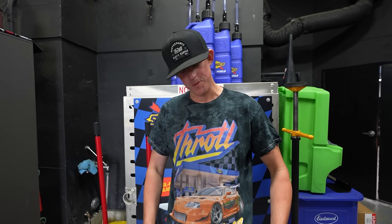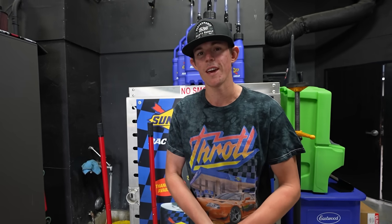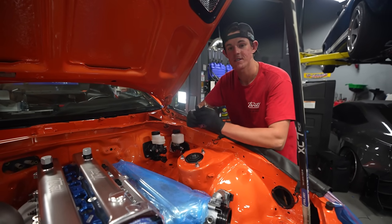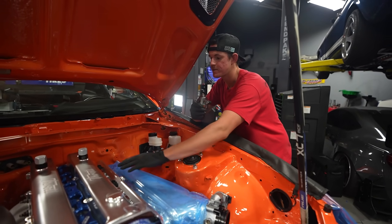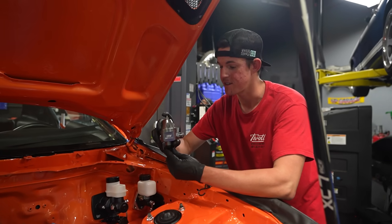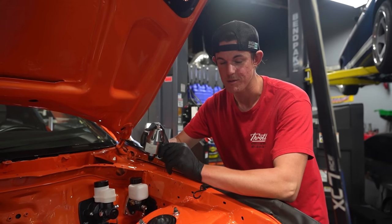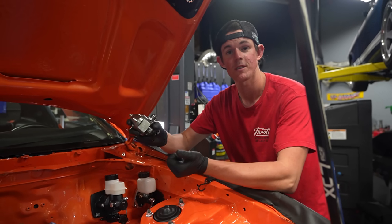Our Mark 4 Supra is actually headed to SEMA thanks to Sunoco. We're going to be hosting a meet and greet on Thursday at 11 a.m. — if you're at SEMA, come check out the car and meet the team. So we've got our Plasma Man fuel rail fitted onto our 2200cc Deatschwerks injectors. We're waiting for our plumbing kits for this, and we're going to have our fuel pressure gauge sitting right on top. Now I need to figure out where to put this fuel pressure regulator — the biggest I think I've seen in the shop. It's running dash 10; this whole fuel system is going to be dash 10.